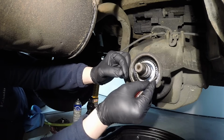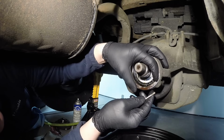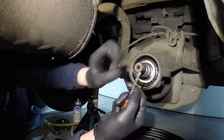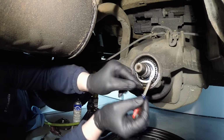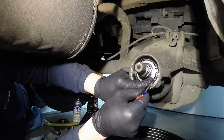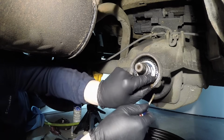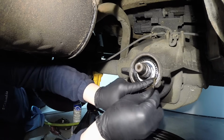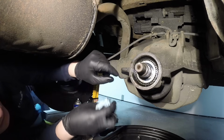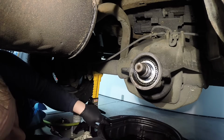So what I use is a small flathead, and I will get it off of there like so. You can see it right here, the reddish orange stuff, the rusty colored stuff. That's the sealant. So this particular screwdriver has a square drive to it, like a square shank on it. So what you can do is scrape it with that square drive on there. You see that? And you can clean it off that way, and of course use this part too. So the whole thing can be used for this, all the way up and around. Right in the edge right there. It's nice and clean now. This outer part right here, that does not matter. I mean, you don't want to build up a garbage on there. So I'll spray some brake clean on there.